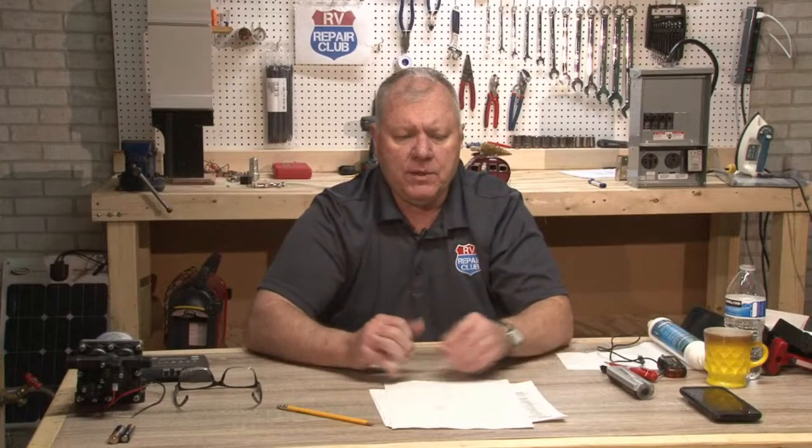And the best thing to do, I would recommend, is go to Go Power, which is gpelectric.com. That is the Go Power site, and they have wonderful calculators on there. Same thing with Zamp, zampsolar.com. What you want to do is look at, first of all, what you're going to run, how much stuff, and how long you need to run it before you need to recharge it. That'll tell you what battery capacity you need. That's the first step, in my opinion: I need to have the right batteries to start with.